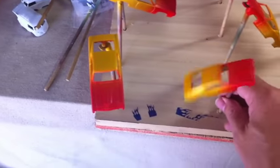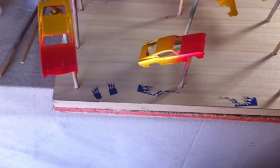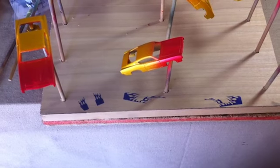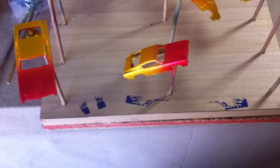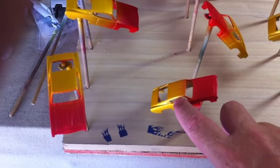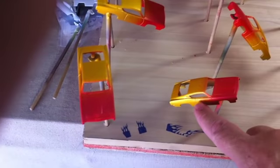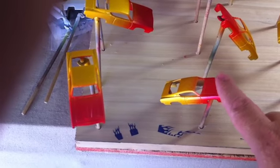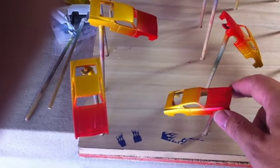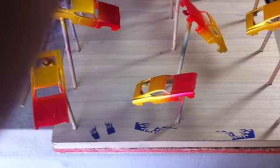Just to reiterate what we did, we started with a base coat of white primer. Then we sprayed that with clear. We let that dry. We sanded it very carefully with 1000 or 1200 grit sandpaper, and then smoothed it all out. Then we went back in. I covered it with a coat of pearl. It was copper or gold or something like that, some color. And then I went back in with a pearl, and then we covered it with a translucent orange, and then we did the front end in a pearl red, and now we've sprayed it with another coat of clear.